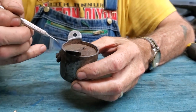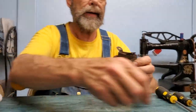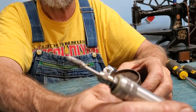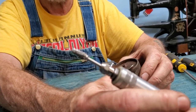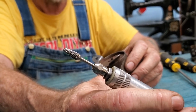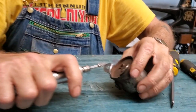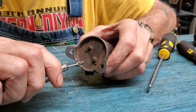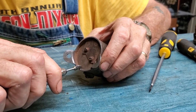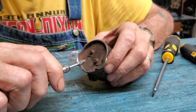To get these apart, I'm going to use a Dremel. Here's the Dremel I use, and I like using these carbide burrs. You can use grinding discs and such — they make a bit of a mess — but these carbide burrs work really well. What I do is come in at an angle on the inside and work that burr back and forth, just maybe a quarter inch on either side around that spot weld.